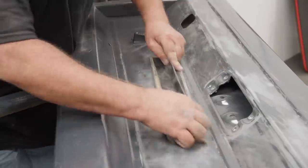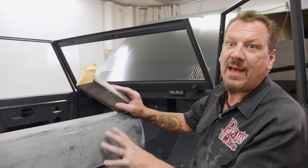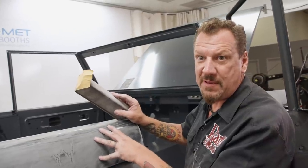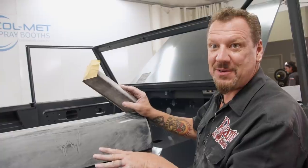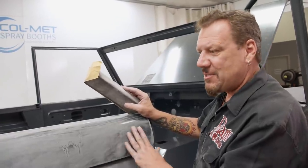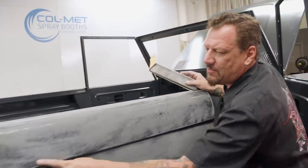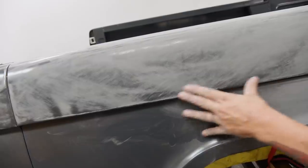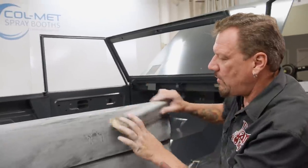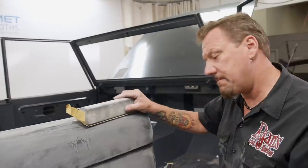First, we're going over the epoxy with 180 grit. With the epoxy, we're in the window now, and we don't have to sand it before we apply our color on top of it. But we did not personally assemble this vehicle, so I want to make sure how straight it is. So it's kind of giving us an idea how straight it is. When we go over the guide coat, you can see some of the shiny sticking through. That means we're low right here already, so we know we're going to need some filler in this area right here. It will promote adhesion, although we don't have to do this since we have an epoxy on it right now.